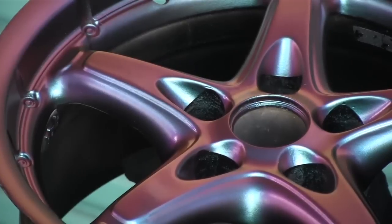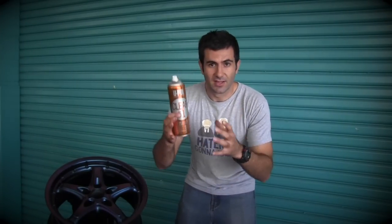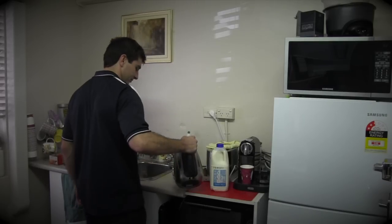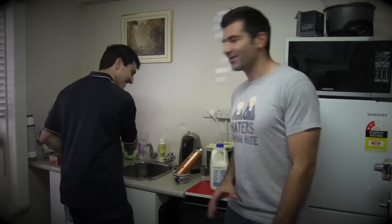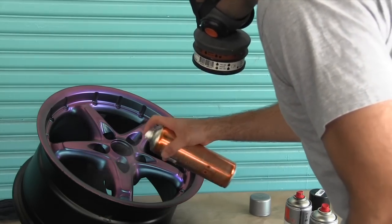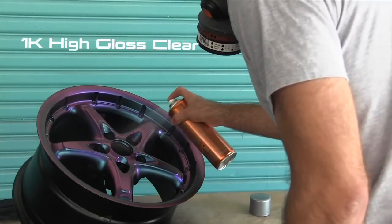So I've left my base coat to dry for 10 minutes and now I'm ready for my clear coat. A handy tip before you spray your clear coat is to put the can in a bowl of hot or boiling water for a few minutes — that will make the clear flow a lot better. By heating up your clear coat it will also stop it from becoming cloudy when you spray it on your job. This is a high gloss acrylic clear from a spray can and it's going to be extremely shiny, so you won't need to buff it. You can if you want, but on wheels it's quite difficult to do that. So I've gone for this high gloss acrylic clear.